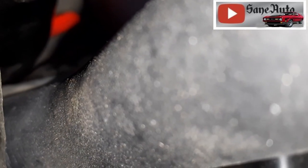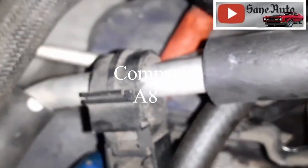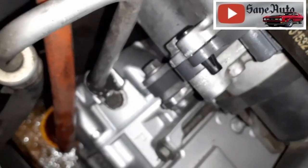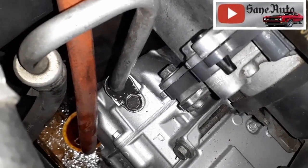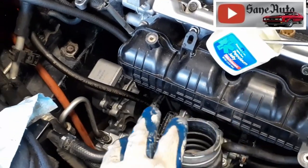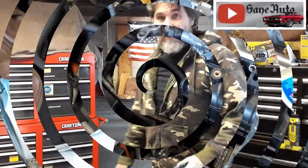Right down there you see that little lever — that is a ball valve, and the lever is attached to the bottom of the catch can. I just push the little lever to the side, and with this drain hose connected to it, when I open the ball valve I can drain it into a container like what I just showed you — without having to pull the catch can out or unscrew it at all. If you're changing the air filter or loosening the snorkel, that's a good time to drain the catch can.